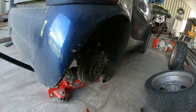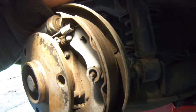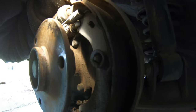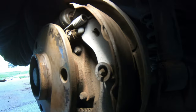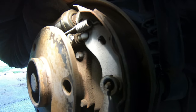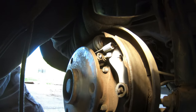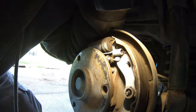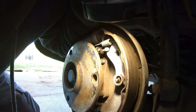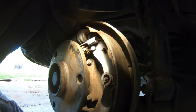If you have an issue that's always bugged you and you want to change the camber, that's the easy way to do it. Put your washer on the inside of the hub rather than the outside so it won't fill up with sand and road debris — at least on the inside it'll be a little more protected. You could also make some kind of metal wedge, or they might even sell a wedge kit that's thicker on one side. But anyway, a thin little washer would probably do the trick.